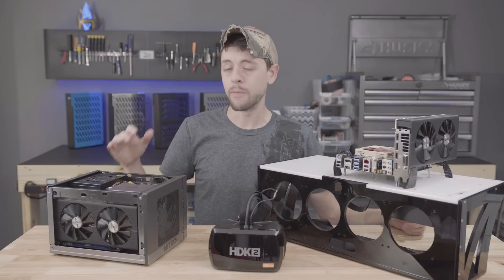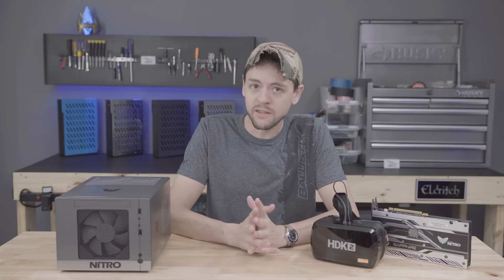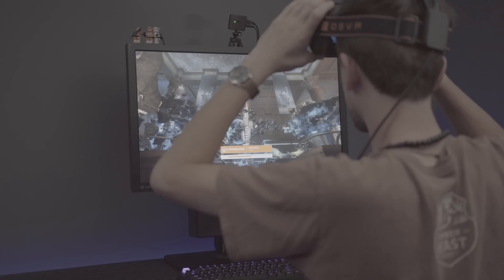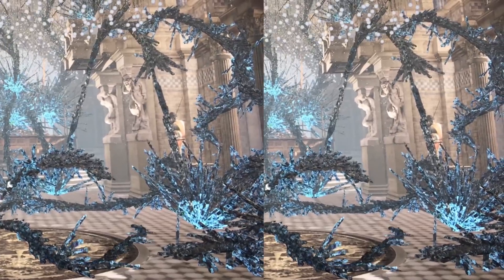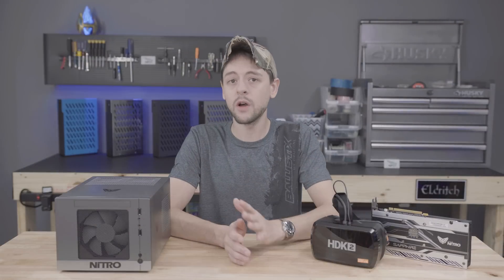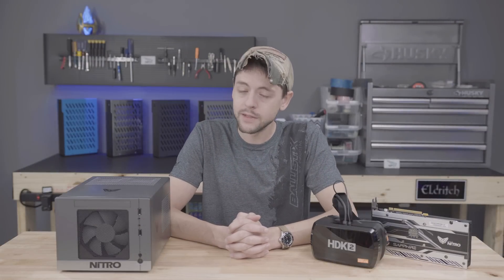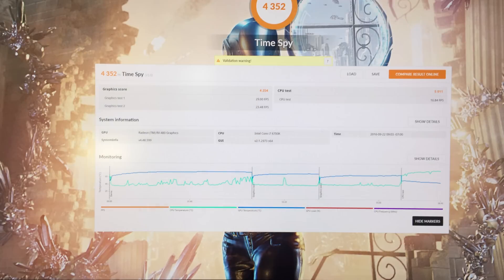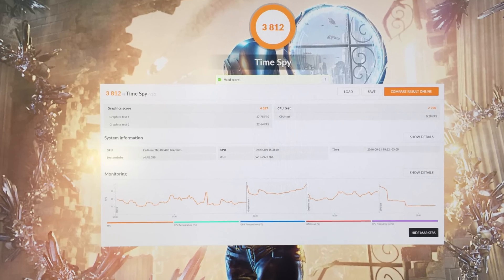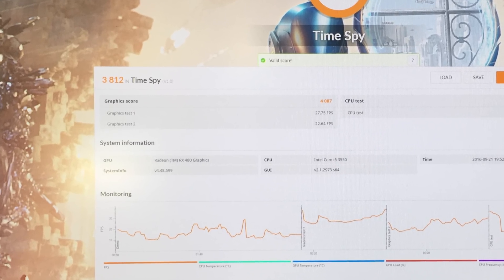It was a long night, but I have my results. As expected, the 6700K system beat the Nitro box in most synthetics, especially in FutureMark, where it dominated. It's really important to run multiple benchmarks and not take any single synthetic score at face value. The reason FutureMark dominated our Nitro box so heavily was because of the CPU score — the 6700K has newer features and a much higher clock speed than the i5-3550. But when looking at the GPU score, they're not too far apart, which shows the i5-3550 isn't bottlenecking the RX 480 too badly.